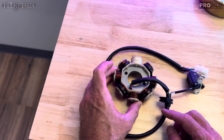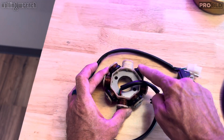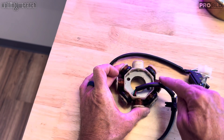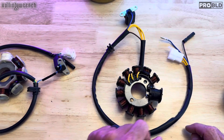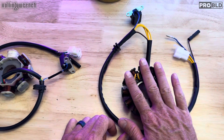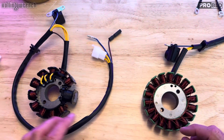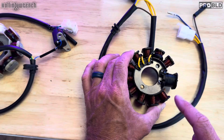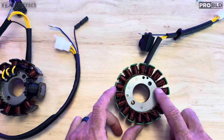For instance, something with just a tiny headlight would use what they call an 8-coil stator, even though there are only 7 charging coils and 1 exciter coil. Same here — 10 charging coils and 1 exciter coil — they call it an 11-pole stator. This is an 18-pole stator and there's no exciter coil. The exciter coil is this guy right here. This one does not have an exciter coil.